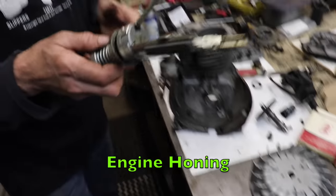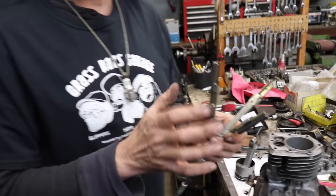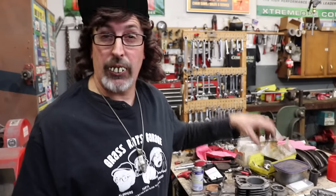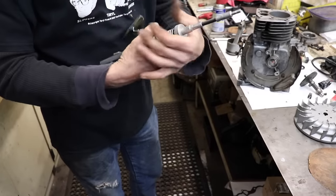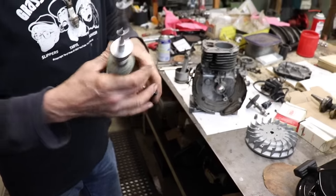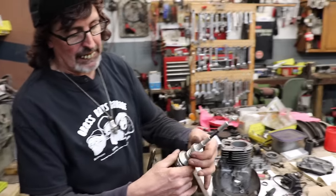So we got our hone. This is the hone I'm going to use. The hone I like to use, and I should have bought one, but I didn't, I was going to buy one before we did this video, but I'm so busy I forgot, are those ones with the little balls on it. Those work the best. Those give you a real good crosshatch than these stone hones. Now this one's adjustable. You can adjust the tension on that spring, and the more tension on that spring, the harder it's going to push on the wall. So I got this thing loosened up as far as it'll go.